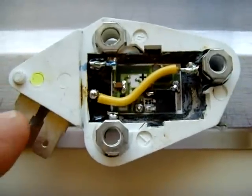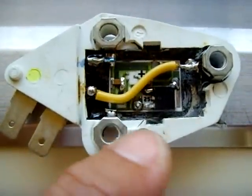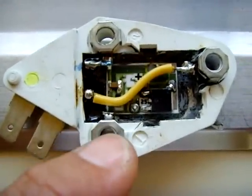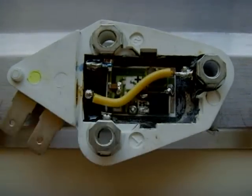This post is still the plus for the diode trio, and this post here was ground. I can connect the ground wire anywhere on the outside of the alternator. So that's how you do it — bypass straight across.